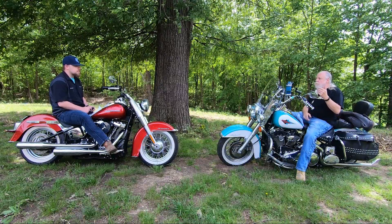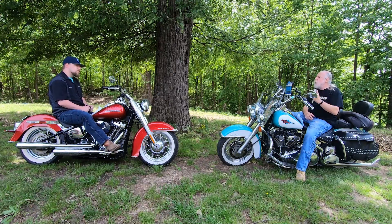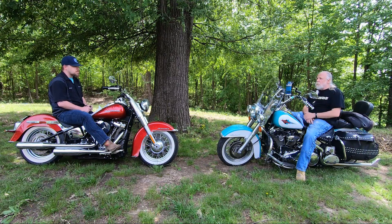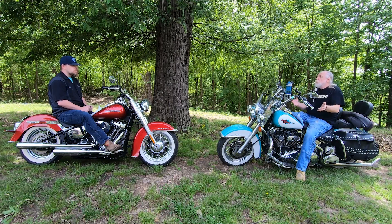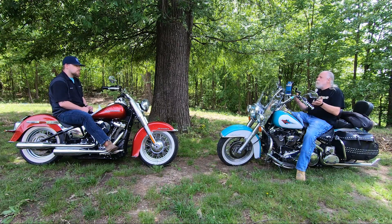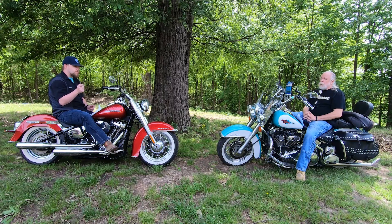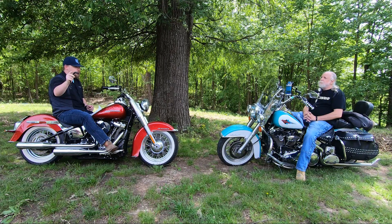So they look good and they're a Harley branded product, but you have over a 50% chance that you're not going to be within spec and your knock retard is not going to work. Sporties don't have knock retard, so it's not really an issue there, but the insulation isn't as good. They're not as good of a wire, and they're more expensive. The 409s are better wires, but we carry the Screaming Eagle for people who want them. The pro race wires last a lot longer, and the boot shape — they always split on the Screaming Eagle wires. There's just too much stress on them.